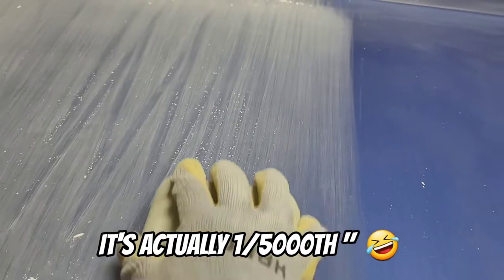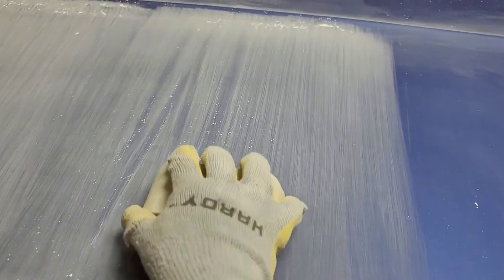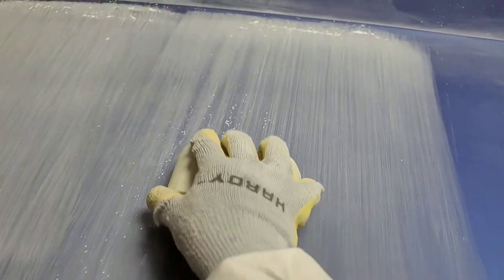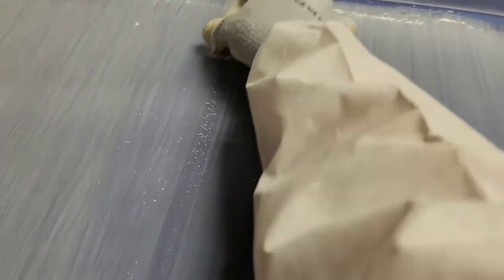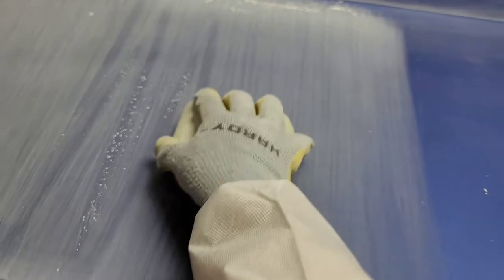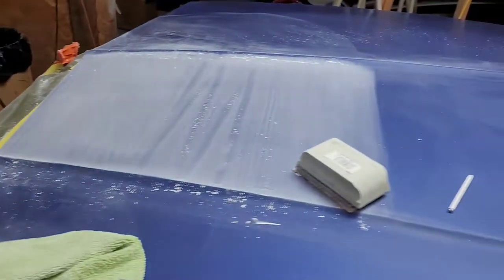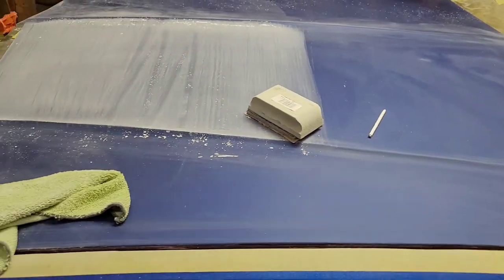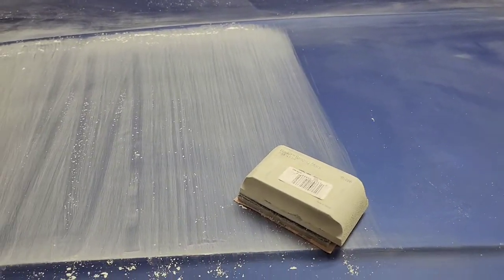But the point is, you can really tell if you are careful and getting that feedback and feeling the resistance as you draw that sanding film across the surface. And that tells you how hard you need to press, how fast you need to go, and how much material you're taking up. So we're going to go ahead and finish the orange, and then I'm gonna do the 1500 on the purple, and then we'll come back to the next stage and I'll show you what to do when I finally start to use water.